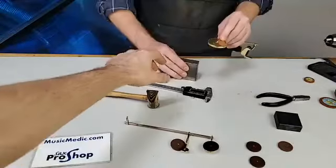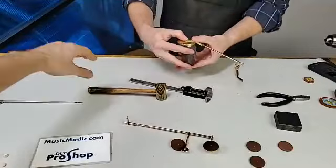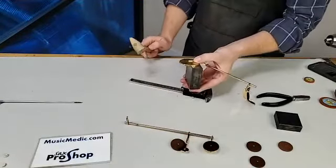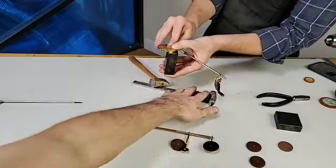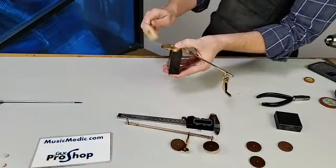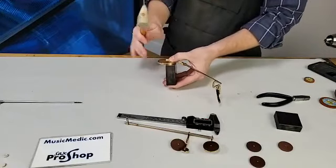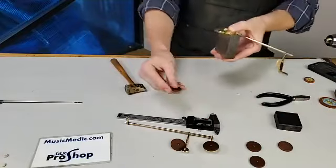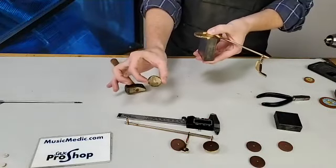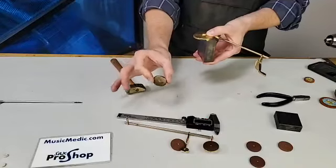Can you turn it like that and do that again so they can see that? Because I don't think anybody in the world knows how to do this. So if this is kicked up like this, and I want to bring it down, I hang it over. So now we're not talking about measuring pad cups, we're talking about leveling pad cups. You got to have a level pad cup. It's real important. We showed you why it's important with this Pringles chip of a pad cup. It gives you two separate measurements.